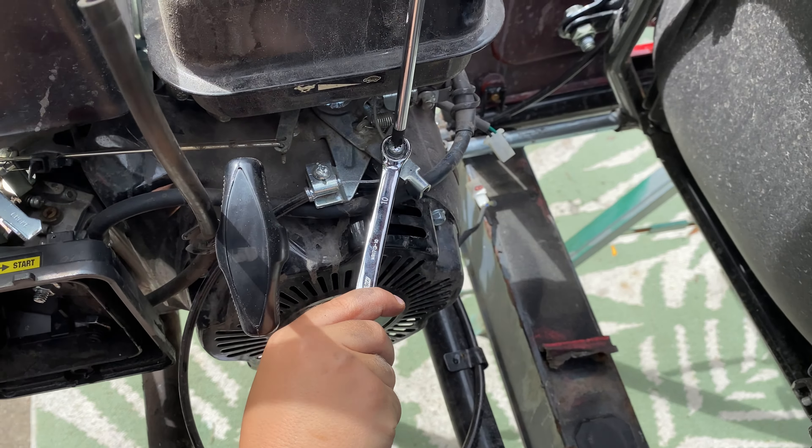While I unbolt all this stuff, I'll explain why we keep the jackshaft on our engine swap. The jackshaft makes the gear ratio about 8 to 1, which makes the cart accelerate really hard and lets Silas do donuts, drifts, and burnouts, but keeps his top speed low — about 30 to 35 miles an hour — which is a lot safer and more usable on our little backyard track. Running the chain straight from the clutch to the rear gear would be about a 5 to 1 ratio, making top speed 45 to 50 mph, with less acceleration and less safety. If you're doing this swap for a kid, definitely keep the jackshaft.